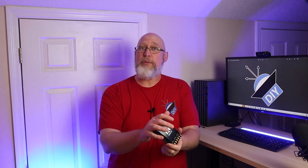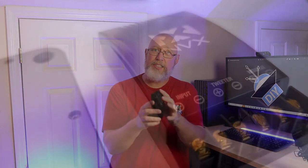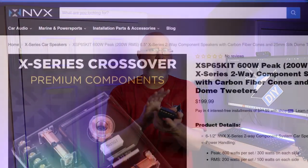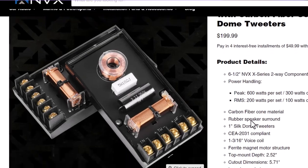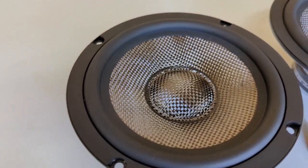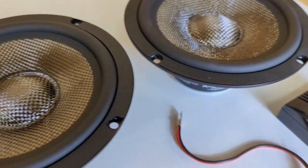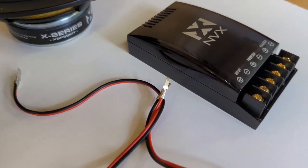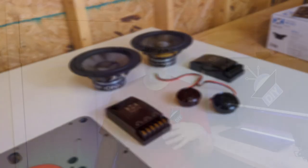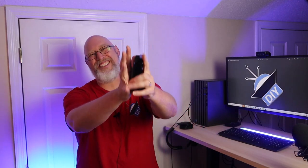Right out of the box the tweeters seem a little bit bright, and that's probably because I'm not using the crossovers that came with the set. These crossovers have a resistor in series with the tweeter — that's commonly done in crossover design when you want to attenuate the tweeter — so I'm going to need to go into the DSP and turn the tweeter down to balance out the sound. The mids are every bit as good as the speakers I just pulled out of the truck, if not better. To learn more about those speakers you can check out the video on the last install I did in this truck. Don't forget to use the code DIYaudio10 at nvx.com. I'm the DIY audio guy and I will see you on the next adventure.